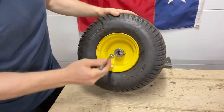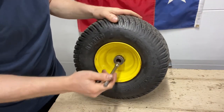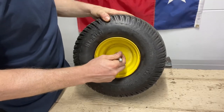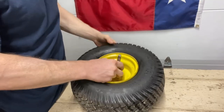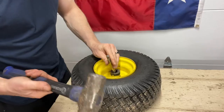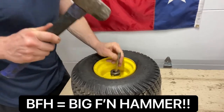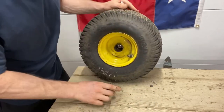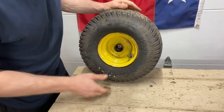First to replace them: we realize that there are two wheel bushings, one on each side. So you have to slide the extension with the fat end down. Slide it down till you feel the tip of that other bushing on the other side where you can get it. Then you just grab your BFH, pop it down, and it just slides out.